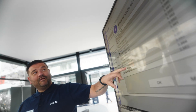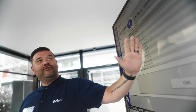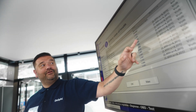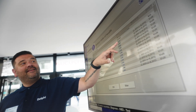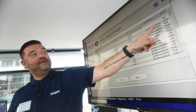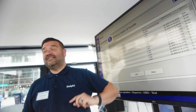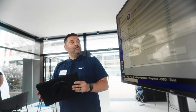Let's have a quick look through the results. We have all of the cells of the battery here — essentially three columns. All of the battery cells are listed, then we move across to the actual values from the car, which are either green or red depending on whether they're in or out of specification. The last column shows the tolerance — as long as the value is between those two numbers, we know the cell is good.